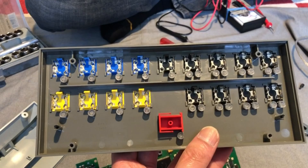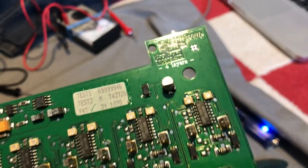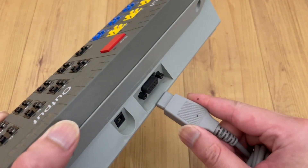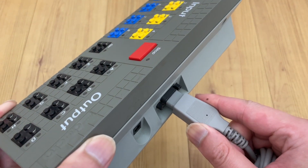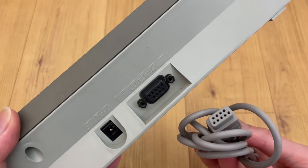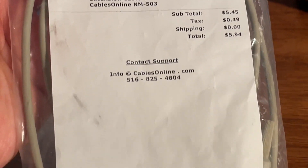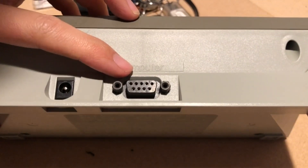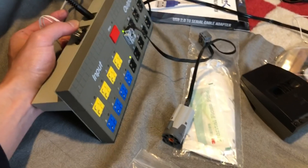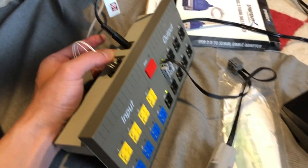They can be finicky to pull apart on removal and line up on installation. This particular mainboard also looked pristine. Eventually, we found out that the Interface B won't work with a standard serial cable like the one used with the Mindstorms infrared tower. It needs a null modem cable, which has some of the leads crossed in a different way, and typically a male and female end. We actually simulated this with individual wires to test our unit before buying a proper cable.